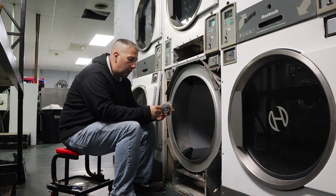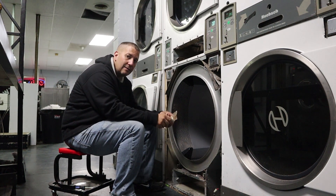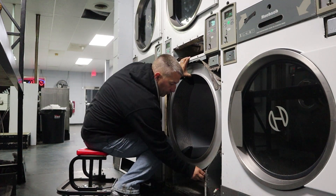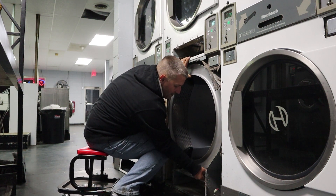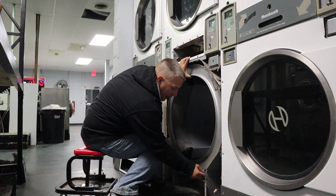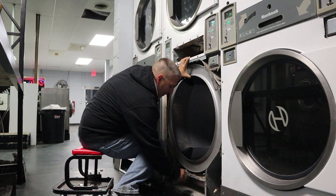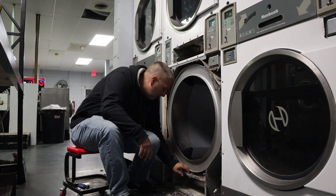I buy these new ones that are crimped now. The rubber part finally wore off, but some of these — this is the type where that bearing will actually get hot enough it'll slide right out, that's why I switched. All I do is pick up on this thing with one hand, pull that off, and I'm actually getting lint that's packed behind the bearing. Look at that — that's all behind this wheel. There's enough of a gap back there that lint and string will get packed in, so clean all that out while you've got a shot at it. Here's all these rubber pieces — that's the wheel coming out.